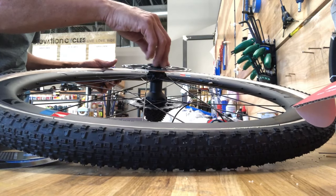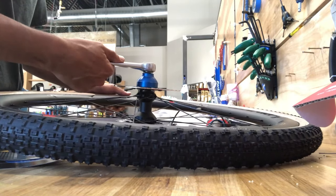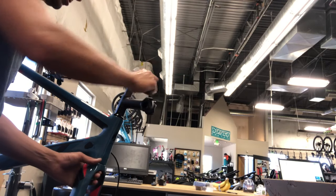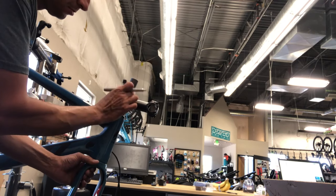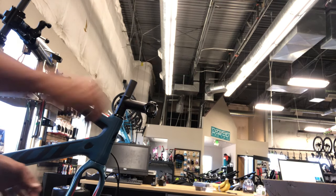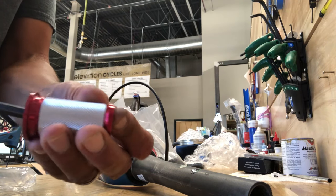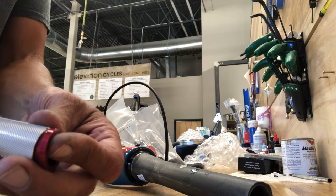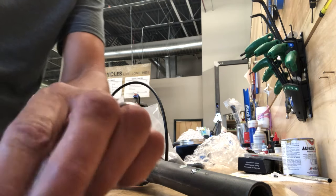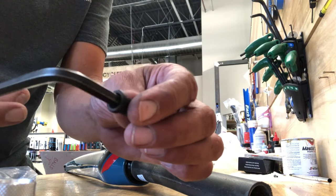Center lock discs are super quick and easy to install. The rotors were maybe a half millimeter or a little more warped, so I had to massage both of them to get them perfectly straight and dialed in. For the fork, you've got to cut the steer tube down. I stacked all the spacers in there — since it'll be sold as a demo bike in a year, I wanted to keep the steer tube somewhat tall. I think I put one spacer on top of the stem. The compression plug has a hollow bolt threaded through the center — accepts a 6mm hex key on the tip and a 5mm standard top cap thread pitch through the center.